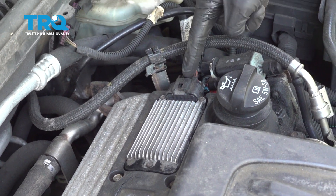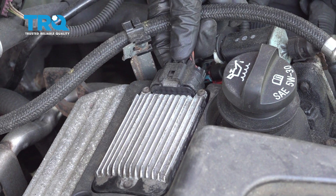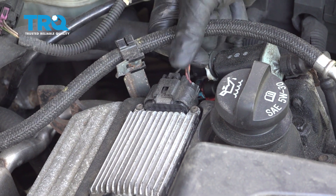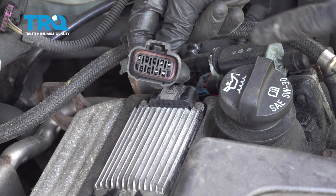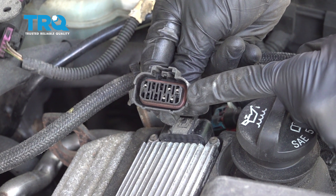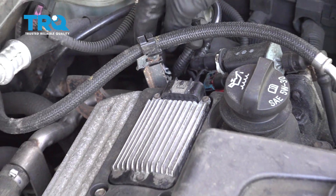To remove this, we're gonna move right over to the electrical connector. To take this off, I'm gonna squeeze on the tab right where my thumb is. You can see the inside opening up. I'll carefully pull this right off. We'll give it a quick inspection — if you see any funny colors, it's probably corrosion and it would need to be dealt with. This one looks fine, so I'll set it aside.